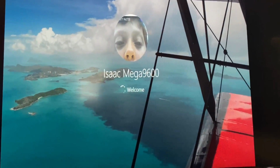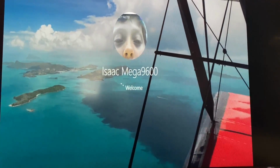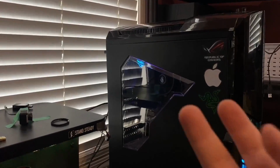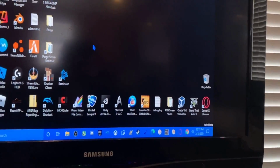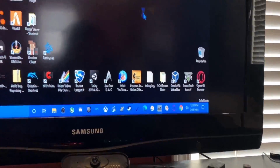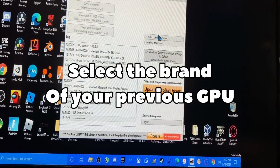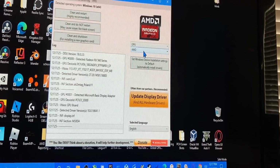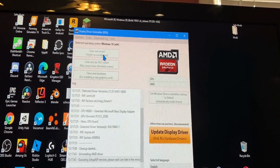I will leave a link in the description to download DDU so you can uninstall your graphics card drivers. Now this is a critical step in installing a brand new graphics card because the drivers could interfere and cause blue screening. So let's launch DDU by just clicking on it. And we are going to select the device type, GPU, AMD. Now we just click clean and restart, and we wait.